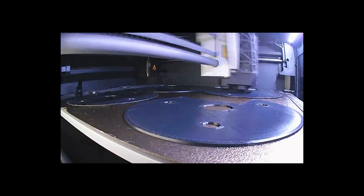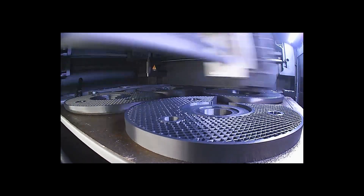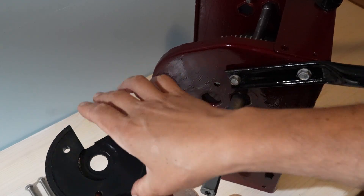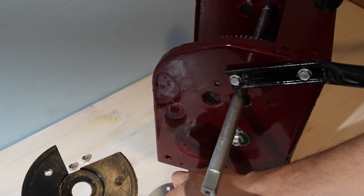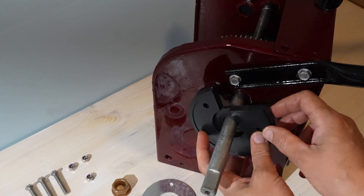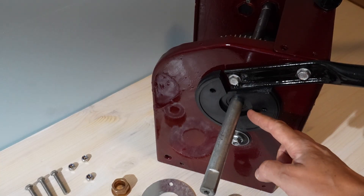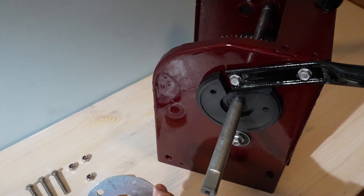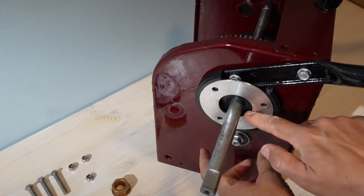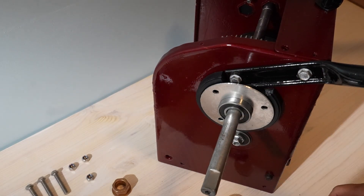The aluminum plate is what really carries the load — the 3D printed holders mostly act as spacers that position the bearings. I used the same system for the auger blades, so now both the main shaft and the blade shaft run on proper bearings instead of worn bushings. The notch for where the handle connects to the frame was built into the 3D design from the start. I also changed the print settings to make them stronger — not 100% infill, but denser than normal — and printed them in ASA for better toughness and outdoor resistance.